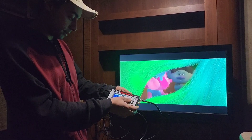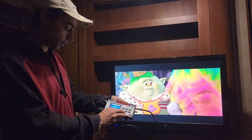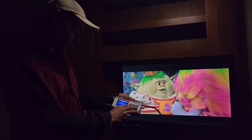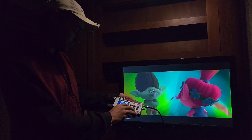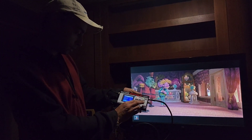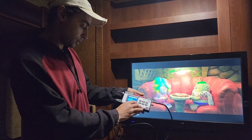Going a bit more in depth — for demodulation options, other TVs only worked under the 256 setting and would not work under 64, so that's important to note. For the channel setup, we have it set to USA Cable under general setup. Video quality was set to high. We did channel 13 — the channel main number and sub number matter, so we have 13-1. Also set to interlace and 1080.